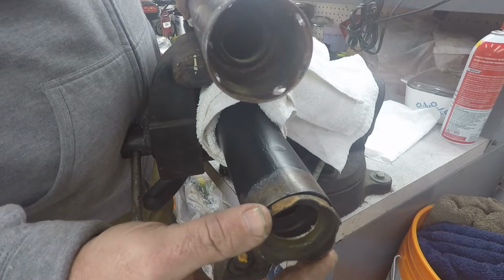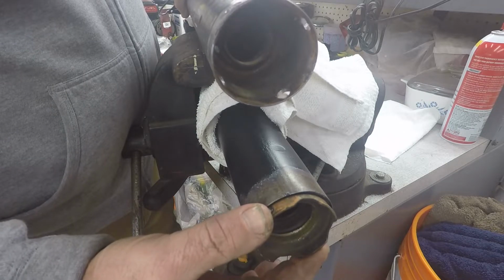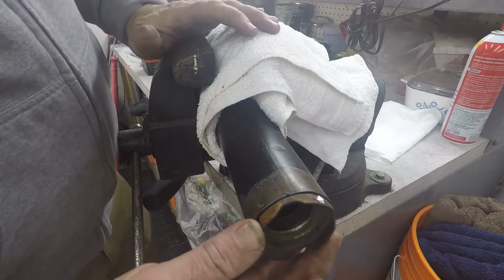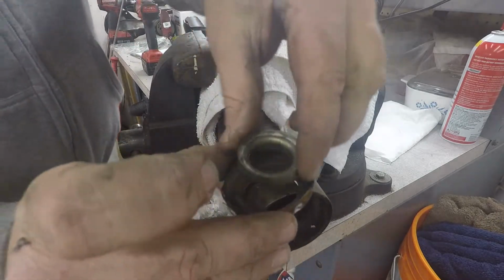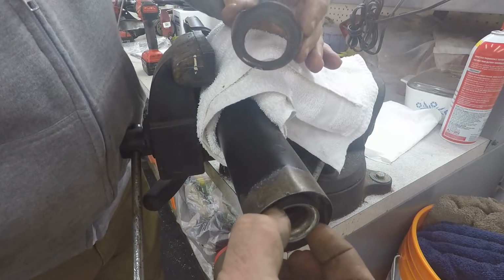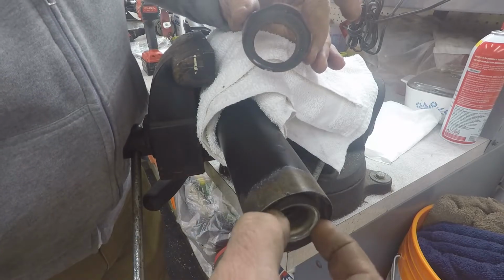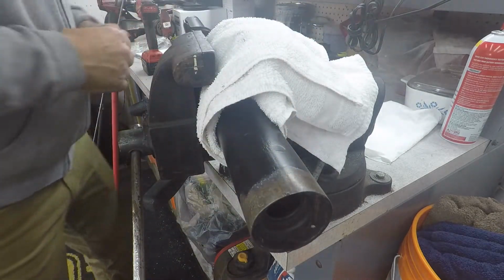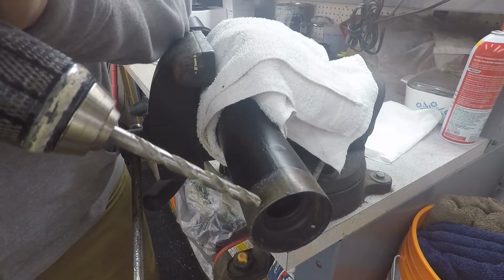Modification that generally you don't have to do if you have the right stuff, but it's pre-Christmas and I won't be able to get the proper bearing. So I have the ability, I'm just changing this housing out. That way I can put this bearing in here that won't fit in here. And even looking on the internet, it's not real clear what component even fits in here. So we're gonna make it work. These are spot welded in 4 spots.